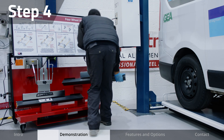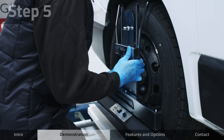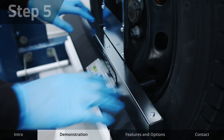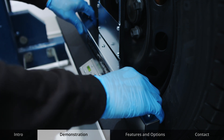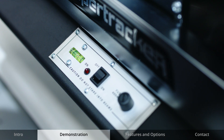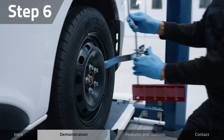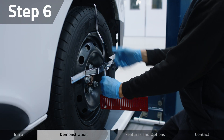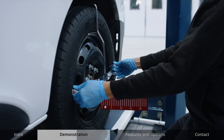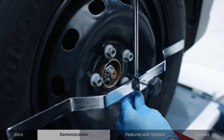Always start at the rear of the vehicle. Place the measuring heads on the rear wheels ensuring a three-point contact with the rim with the adjustable rim buttons, which can be altered. Level the head using the inbuilt spirit level. Place the scale on the front wheel positioning the hanging rod vertically and the cross frame horizontal to the centre point of the wheel. Ensure there are three points in contact with the wheel by moving the position of the hanger.